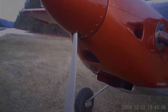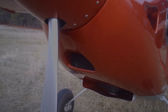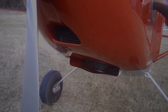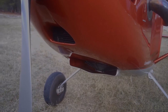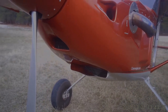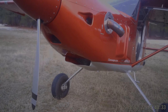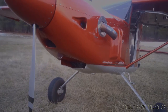I'm going to give you a close-up here of some of our intakes. The upper one in the center of the screen is the oil cooler intake; the lower is the radiator — you can see a fan in there. We really have what's turned out to be a very effective updraft cooling system for the engine. You'll see also in the upper corner a NACA scoop, but the intent there was just to blow some cold air over the headers, which are stainless steel four-into-one headers on either side.